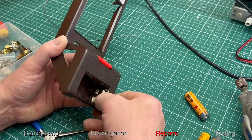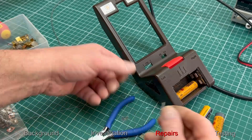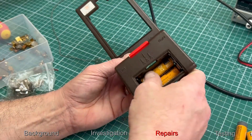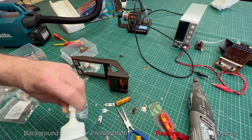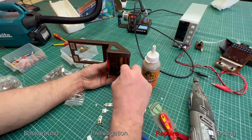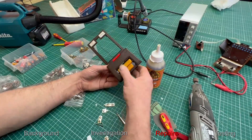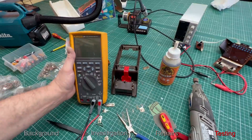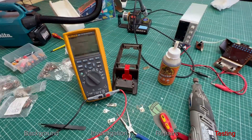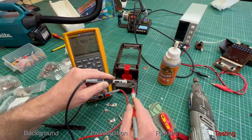We'll clean and dry out the battery compartment and clean up the original contacts we're going to reuse. You can never find exactly the same size contacts that were originally fitted, so you tend to have to cut down or modify the replacement ones slightly so they fit into position. Do a dry fit of the batteries as you go along to make sure everything is in the correct position, and once happy, glue some of the new battery contacts into place to retain them. With that done, install a set of batteries, let the whole thing dry properly, then take a voltage reading across the positive and negative terminals to confirm around 6 volts. We've got a good battery connection — everything looks good.